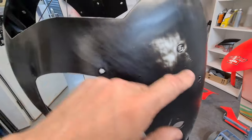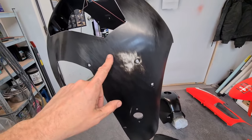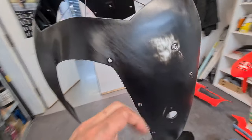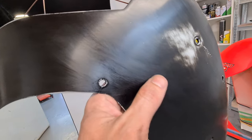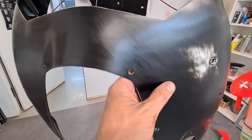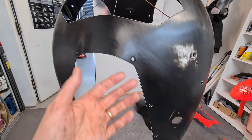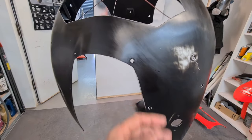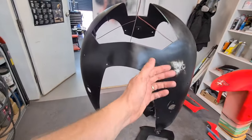There is dust contamination — it's pulled it out from when it's been previously painted, and here we've got a little slight indentation. I could clear coat over that and it will cover it, but I might just sand that back out. If I put base coat on here and then put a sticker over base coat, which you shouldn't do anyway, it would show through. That wants to be flat and level. I can just base coat this, clear coat it, then level the clear coat out — that will be easier than removing more paint.